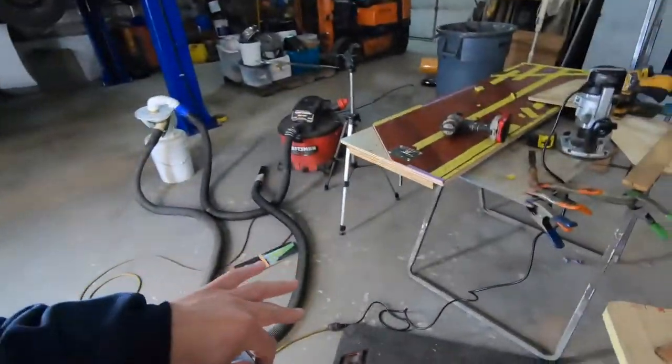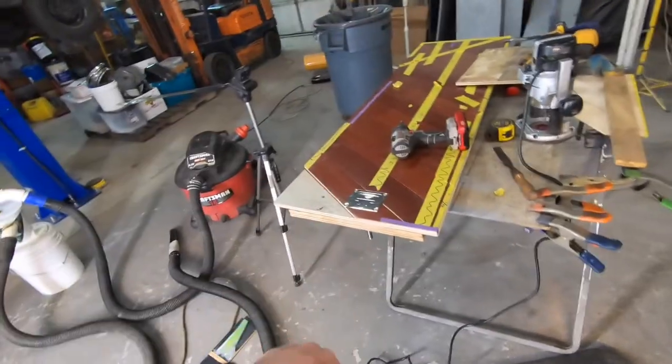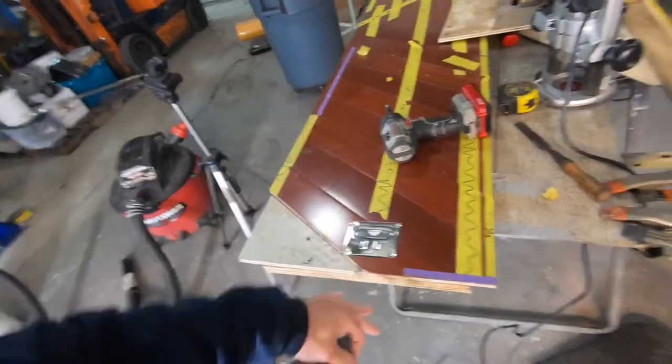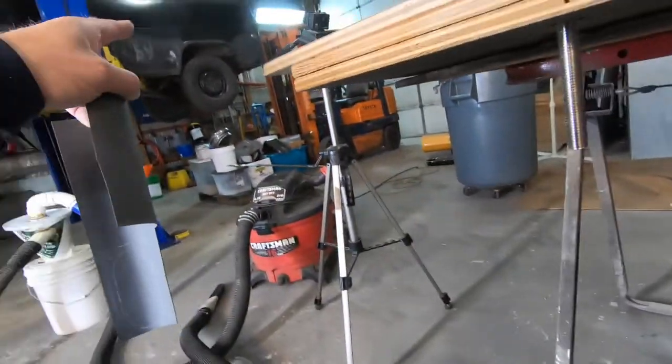And it's temporarily mocked up, screwed down. The floors are screwed down. Nothing is glued down. But once I'm good with this being perfect, like, okay, we can move on to the next hatch. This is gonna come all back apart, and we're gonna glue the hardwood floors back down with that glue. So anyways, we're gonna fit that in the bus, and then we're gonna mark this thread similar to the other thread that I did on the hatch for the back bedroom. See if that depth for the latches is continuous through the bus. Write that measurement, which I think is 1 5/8, and do that consistently through the rest of them.